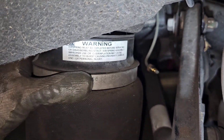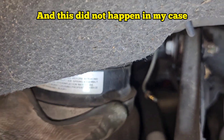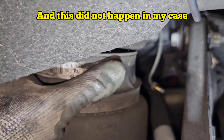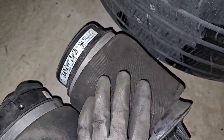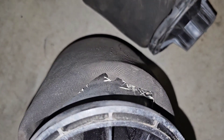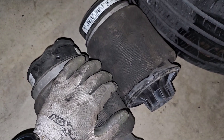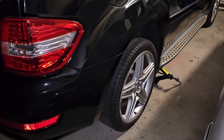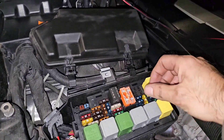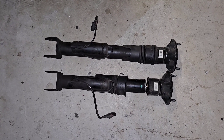The only way to remove the white retainer without damaging it is to unscrew the air shocks by rotating clockwise. The right hand side was only leaky, but the left hand side is completely shredded and torn — it's useless. Do yourself a favor and replace it. If your car has 100k on the clock, it's probably a good time to replace both. I've jacked up the car just a little to help the pump reach the correct height initially, and I'm putting the 40 amp fuse back so the compressor can work. I've also replaced both shocks which had oil leaks.